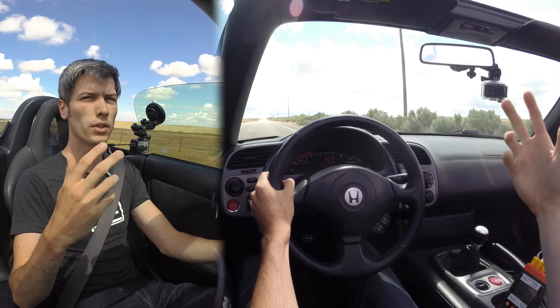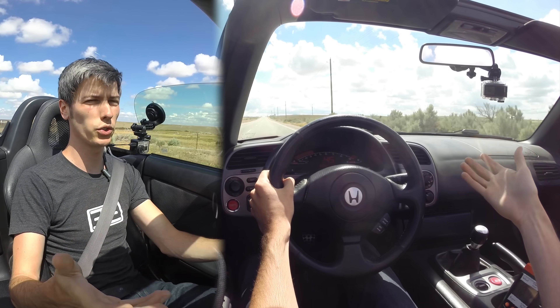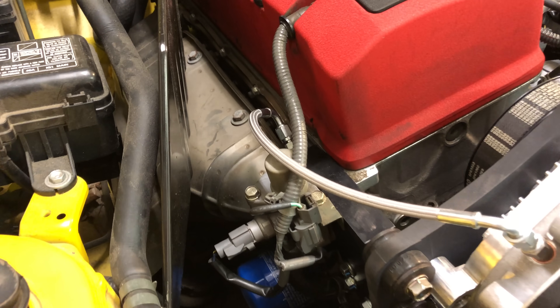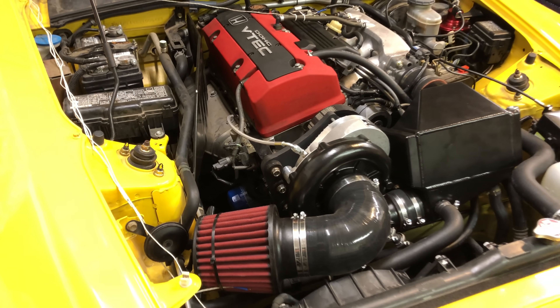This has been pretty fascinating — I wasn't expecting to see numbers in this range. It's actually a pretty significant difference between where the intake is versus ambient conditions if you could achieve best-case airflow. Two potential solutions would be to either relocate that air intake to draw it closer to the front of the car, or put in a heat shield between the intake and the exhaust to block hot air from reaching it. If you have any questions or comments, feel free to leave those below. Thanks for watching.